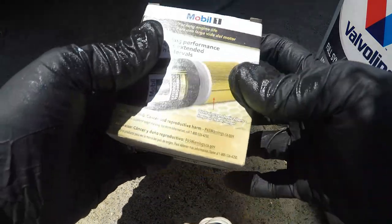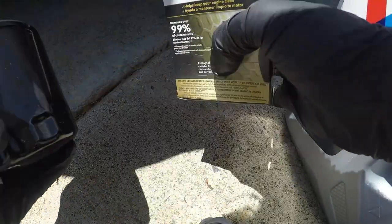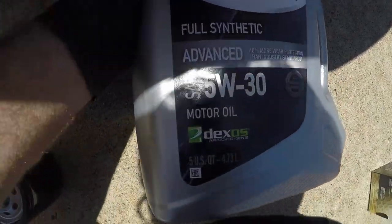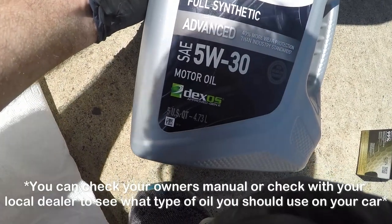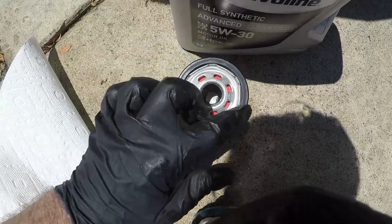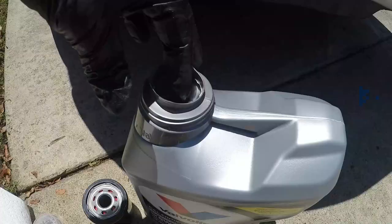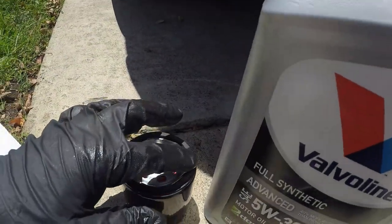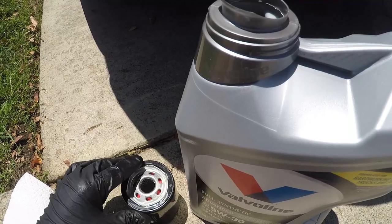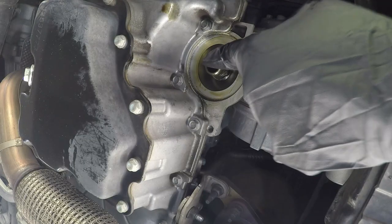The next step is we're going to change out the oil filter. I'm using a Mobil 1 oil filter, part number M1-113A. Now one thing you want to do — when I was looking at this — we want to use a 5W-30 Dexos, which is what I was told they use at the dealership. First things first, we're going to put a little bit of oil around the rim of the oil filter right there so it'll go ahead and help it seal up pretty good. Dip your finger in the oil a little bit and just rub it around the perimeter of the filter to help it seal up when we install it.